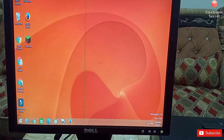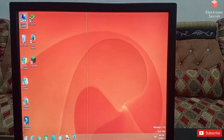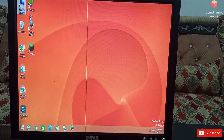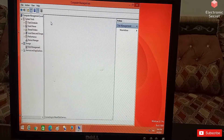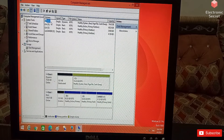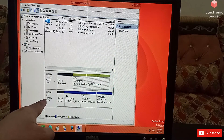You can see that our desktop is in working condition. I have connected the laptop drive which was not in use and was extra, and now I am utilizing it in my desktop. I will show you in the properties. Click on Storage, then Disk Management — it will show all the disks. This is our laptop drive which I connected, and this is the main drive. It's showing 74.53 GB because it is an 80 GB drive, and this is the 160 GB main drive showing slightly less as well.